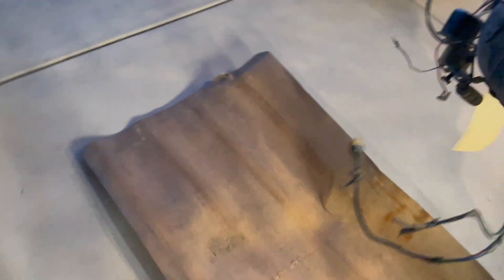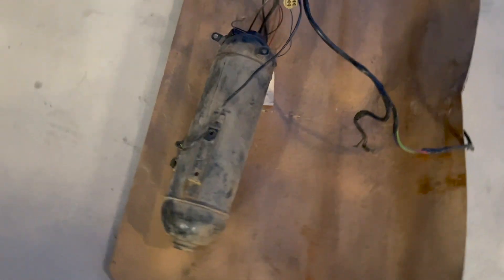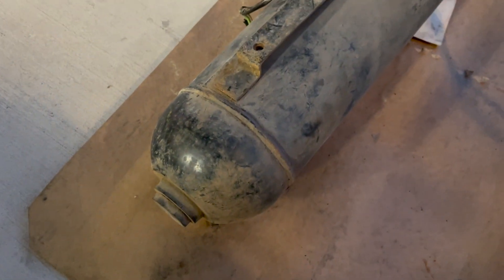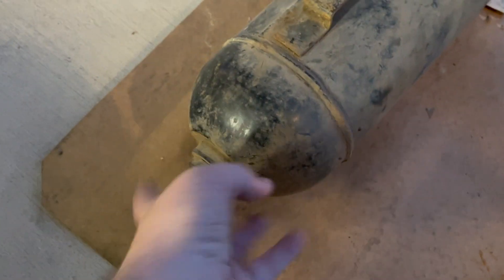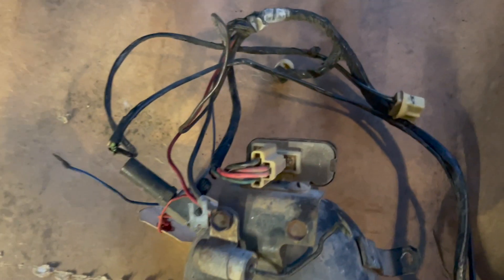What we have here is a level air tank. This is the standard tank that you usually see in a 58. There were three different variations of the tank, and this is the one that came in the rebuild kit. The difference on these versus the ones that originally came in the cars is that this top section where you see those end caps was completely round originally. Along with the wiring harness and the horn relay at the top, the voltage regulator would connect to this bracket here. And then you have the valves coming out of the tank there.